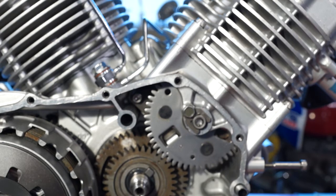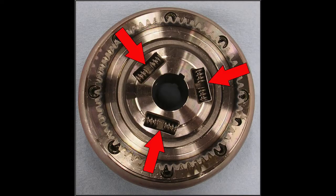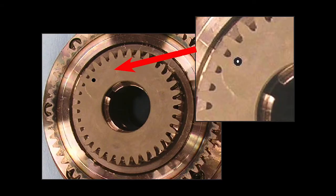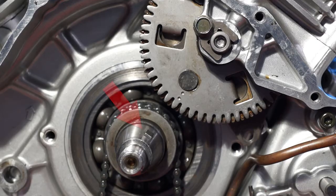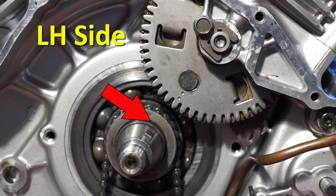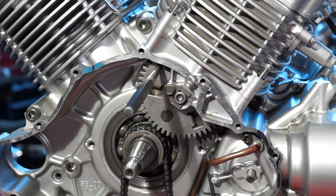You can now remove the punch from the cam chain drive gear. Support both cam chains so they don't bind and rotate the crankshaft until the Woodruff key on the left side of the crankshaft lines up with the cam chain drive gear center line. Install two damper springs and two limiter dowels into each of the three slots on the back of the generator rotor. Make sure the punch mark on the drive gear is aligned with the Woodruff key groove on the rotor, and that the three engagement dogs are centered between the damper springs and dowels, then push the gear into the rotor and make sure to fully seat the gear down into the damper springs. Align the Woodruff key on the left side of the crank and the double punch marks on the left cam chain drive gear, then insert the 6mm taper punch into the cam chain drive gear alignment hole to align the teeth.